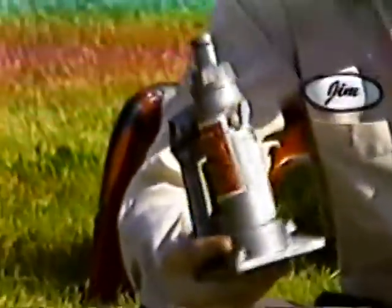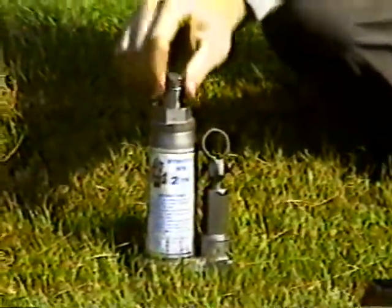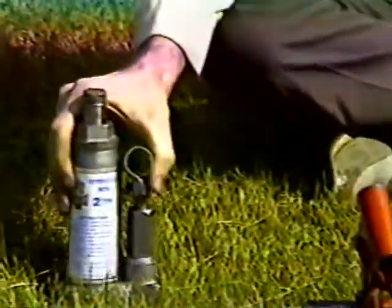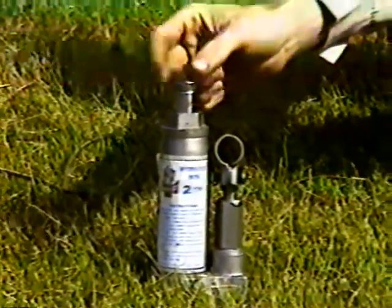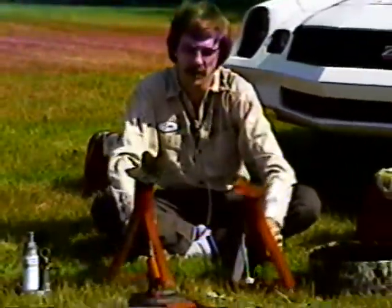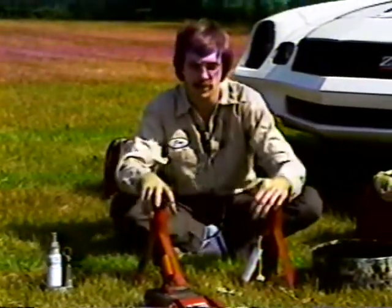Let's start with this machine right here — it's called a hydraulic jack. It works pretty simply: it's got a little hydraulic screw, you take your pliers, tighten it up, put the rod in, and start jacking. I'm not going to demonstrate it because I don't like this jack at all — it's dangerous. When you have a little hydraulic jack like this, you have to get axle stands to go with it. It's kind of an unnecessary extra expense to buy this jack and then need something additional.